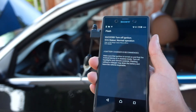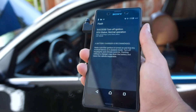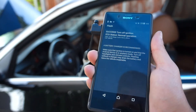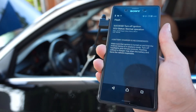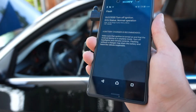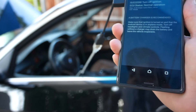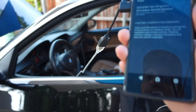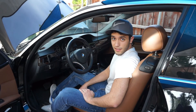After that, just follow the instructions on the phone: turn off the ignition and wait a little bit. If you have an automatic with the Alpina flash or XHP flash, you're going to have to wait like five minutes before you drive it. What happens is your transmission loses its position reference — it doesn't know where the gears are and has to relearn that. Otherwise you're going to be in third gear at a stop. It just does some weird stuff, so just wait.